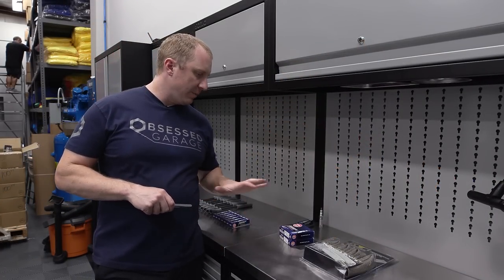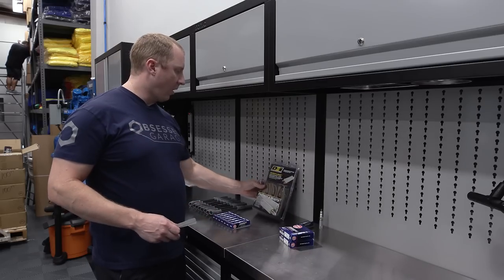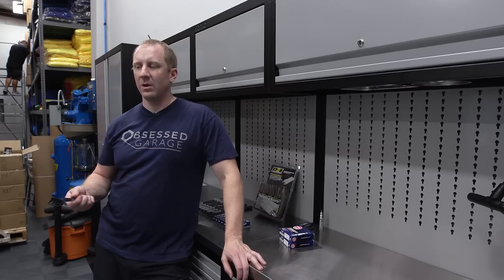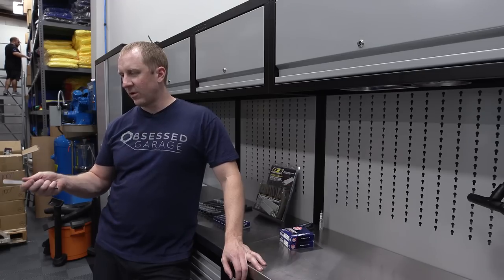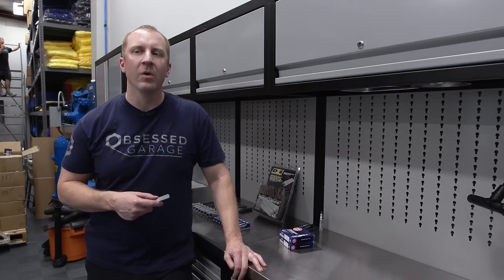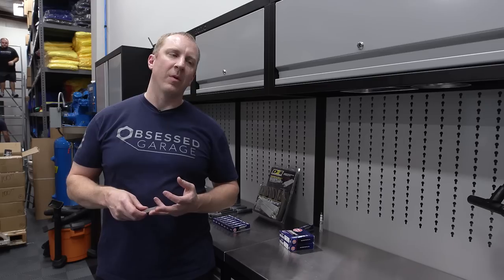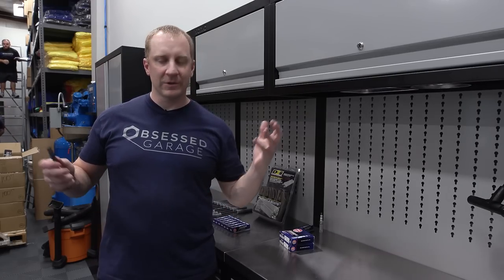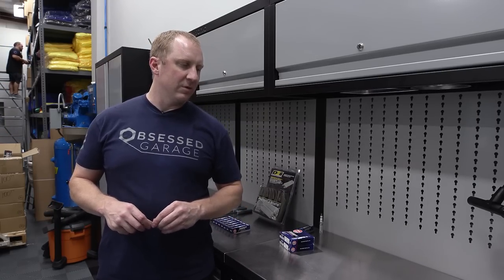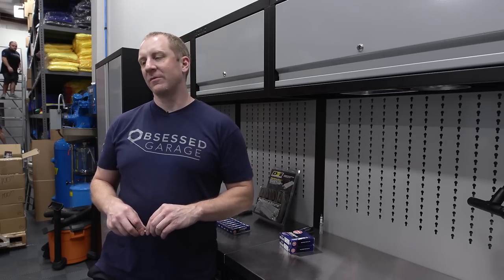Today's video is to get proper plug wires, plugs, and boots in the car to make sure that I'm running properly. I got a check engine light and threw a code. A lot of guys that own LT4s have been telling me you really don't have a choice — you're going to get an O2 sensor code. But I'm also getting a misfire code, so I'm going to change the plug wires and gap them properly because the plugs I got weren't correct. I didn't do enough research — this car is just a fun little project.